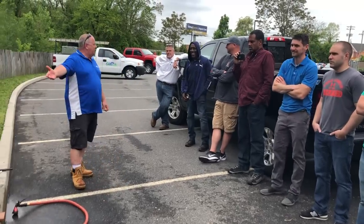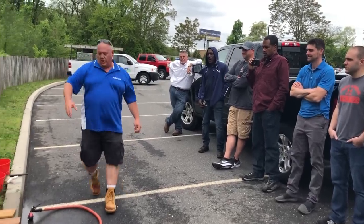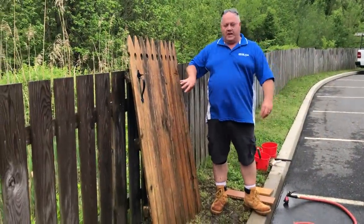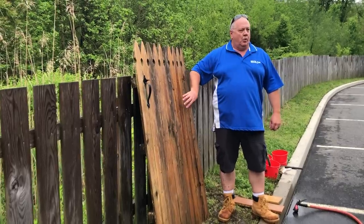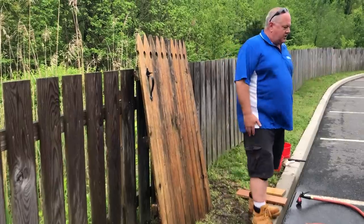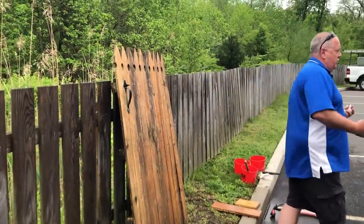Seriously? I mean, do you want to clean it once or twice? Do you want to have a good result? Or would you rather clean it once and get something like this? I mean, you're looking at it with your own eyes. This is sodium metasilicate. One time, much better, right? In the prep side, it's all really just a matter of knowing what else is out there, what you can use.